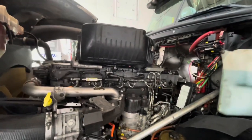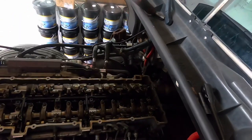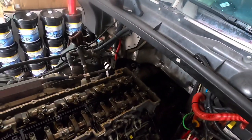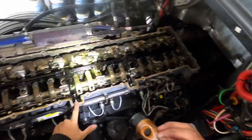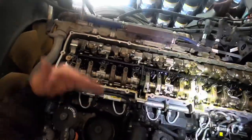We are back - we took off everything that was in the way, which is your valve covers, air filter, and all that. We have our engine set to time, we are TDC1. You can see the timing marks there - I marked it with white paint. We are TDC1, so what we're going to do now is take this entire thing apart: start off with our injector harness, remove the front, remove the rear, and then take off our rocker assembly, intake and exhaust.